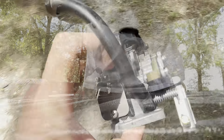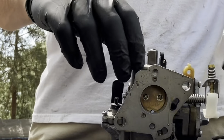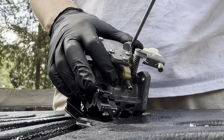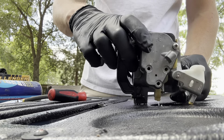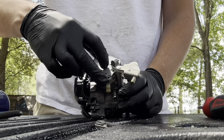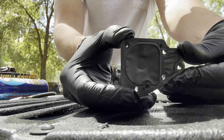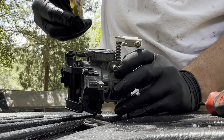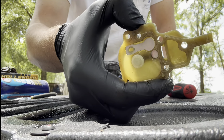Now we're going to put this on the tailgate and get this cleaned up. This right here is your fuel pump of the carb. It's spring loaded, so you want to keep your thumb or finger down while you get this last screw out. Gently let it off — it's your diaphragm on your fuel pump. If there's any tears or holes in this it will have to be replaced. This one looks good. Then this part should come off. Inspect these flappers right here — that big silver piece. These look good.